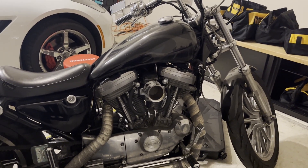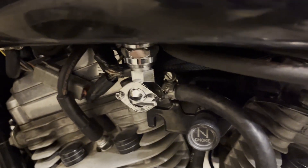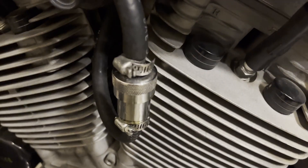Normally I use a straw from Six Flags that I set on my petcock to drain the fuel — just disconnect it, put the straw in, and drain into a gas can. I don't have my straw today, but I do have a filter here, so I'll just loosen this top hose clamp, unscrew the filter, and drain it from there.